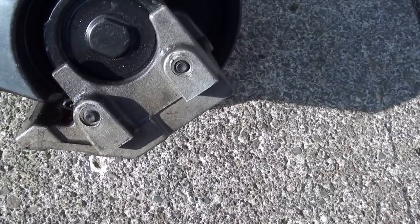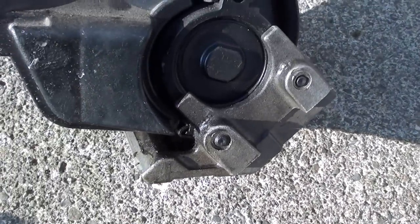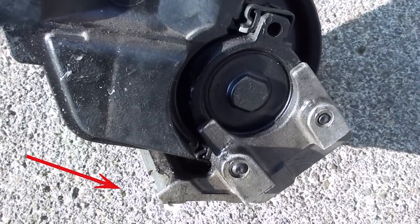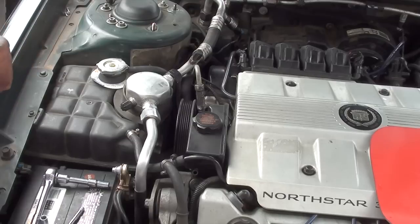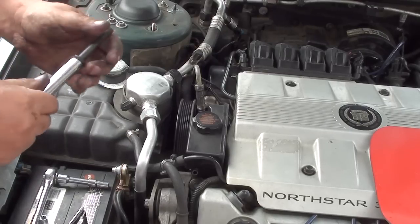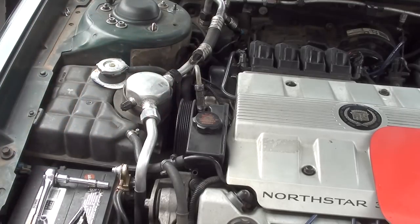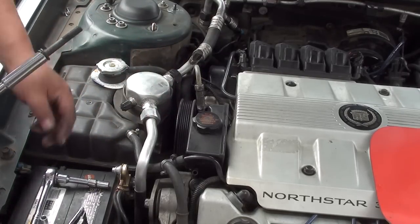This is towards the front, and this is the back of the pump, so this lip is going to be towards the front. We've got our pump out. I got my pump at an auto wrecking yard so I didn't have to replace the pulleys. If you have to exchange your pulleys, you're going to have to go to a parts store, rent a puller, remove your pulley, and install the new one. But I didn't have to do that — this way is much easier.